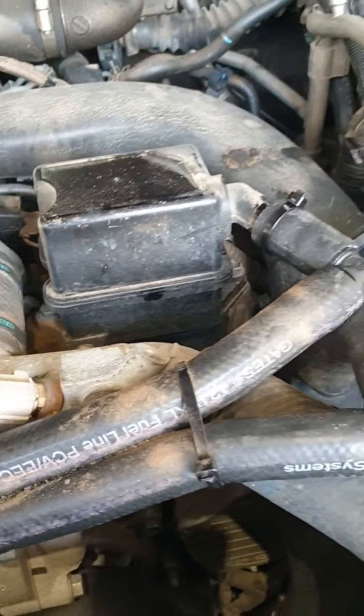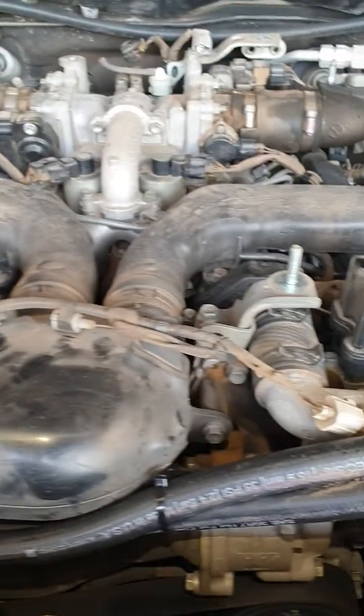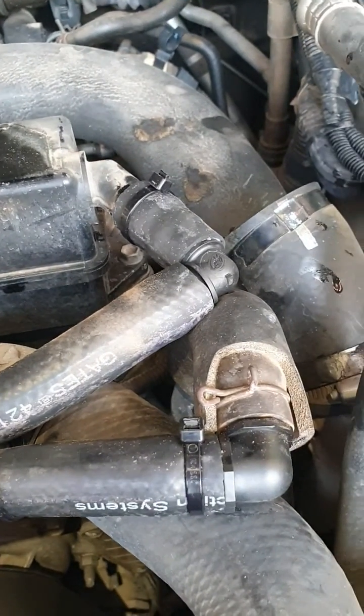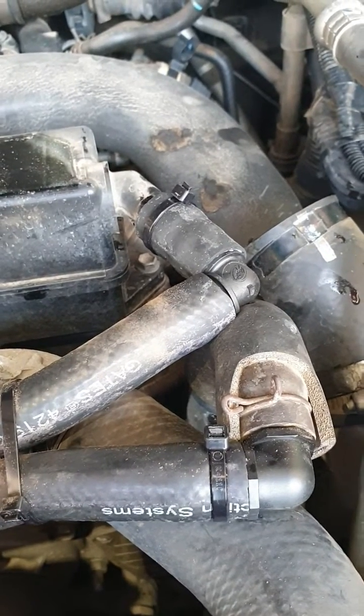So it just goes to show you a bit of a silly design and an absolute must. Put a catch can system in, get that oily fumes out of that inlet and protect your LC200 from choking things up and causing you grief much earlier than it should. Great design here — dumping all the oily fumes in the passenger turbo.